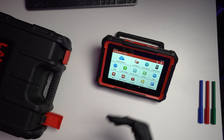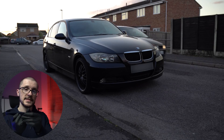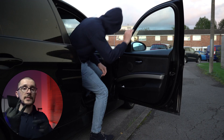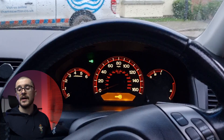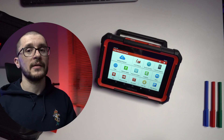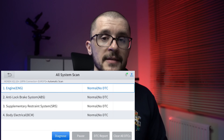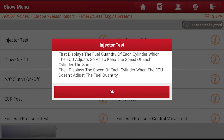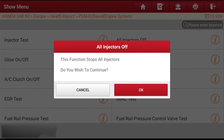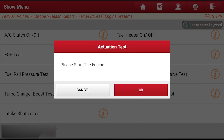I've tested this tool on four different vehicles: a 5-series BMW, a 3-series BMW — both different generations, one F-series and one E-series. To spice things up I used a Honda Accord, which is a completely different layout, and to my surprise this unit worked very well on it. My X-Tool could see only four ECUs on the Honda Accord; the Launch was capable of seeing five. Also, the X-Tool was struggling with the actuator tests on the Honda Accord. Launch had absolutely no problem performing the majority of those actuator tests, with only a few that weren't working 100%, but overall it had more consistent results.